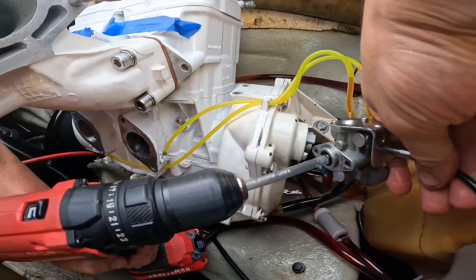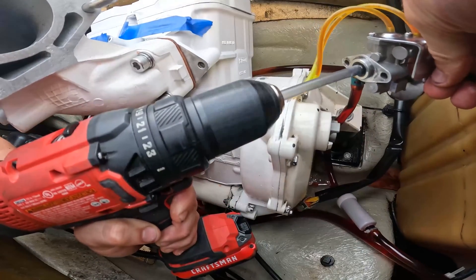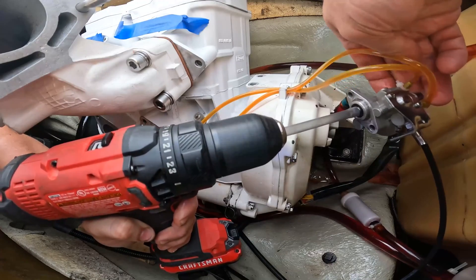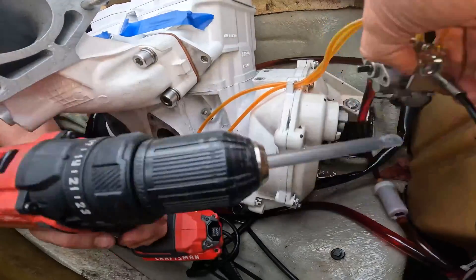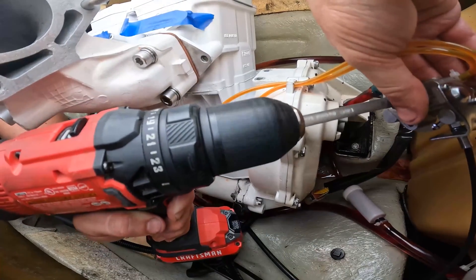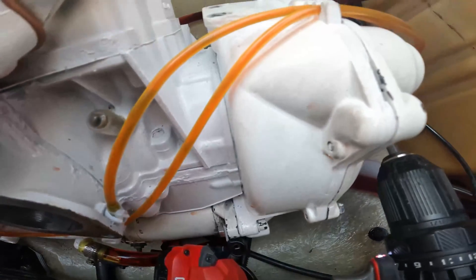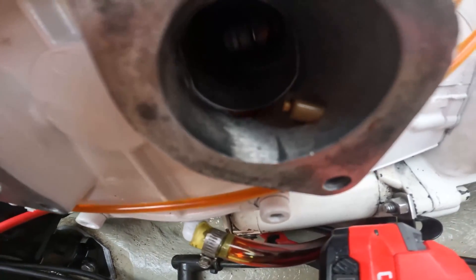I'm going to get a picture where you can see the oil go through. These are all primed and there are no air bubbles in there, so that's good. You know when it looks like this — I'll run it a little bit more just to make sure you can see oil going through those injector fittings.